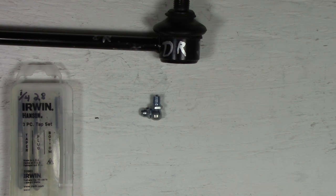All right, I've got my grease fitting oriented the right way. I've got the right spacer washers underneath it, and I have full range of motion on that ball joint without any issue whatsoever. So now I'm ready to put some grease into it. So I'm gonna put my grease gun on the fitting, lock it down. And then I'm gonna show you the grease going through the actual joint. There it is there. So let's start pumping, see what kind of grease we get into it.